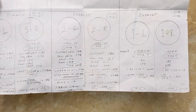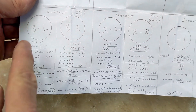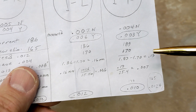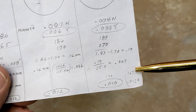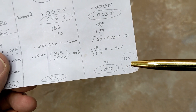If you remember, I have labeled all my cylinders — exhaust side, cylinder 1 left side, cylinder 1 right side, cylinder 3 left side, and so on. I did go down to the motorcycle shop today and replace the 170 shim with a 165, which will bump my value from 10 thousandths to 12 thousandths.